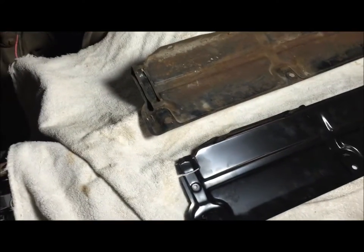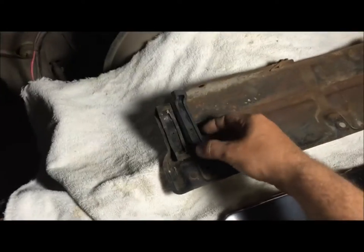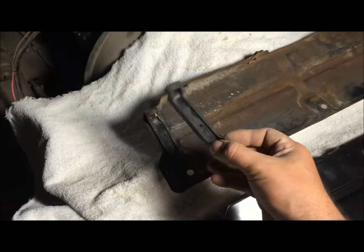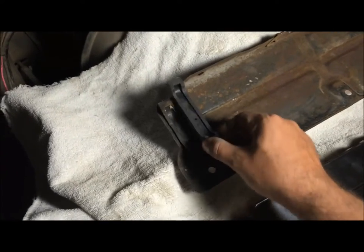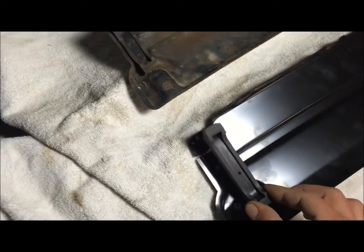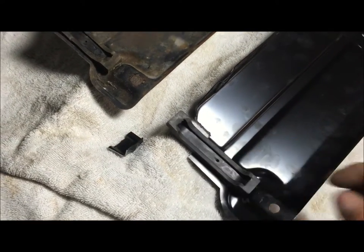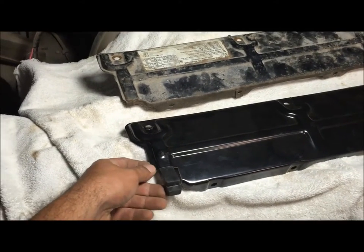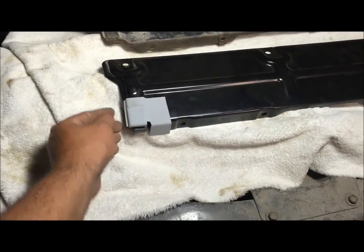The other side is fine - you don't have to do anything to that side. But on this side you can see where I cut the piece. The problem is the four-core is wider, and you're also going to have to buy these support bushings - they're like twenty-five dollars and they're bigger. You can see right here where they hit, so that's why they cut that out and put this back in. The piece kind of squishes up so they weld that piece on there.